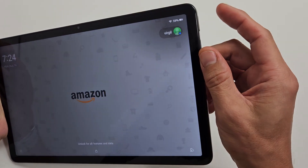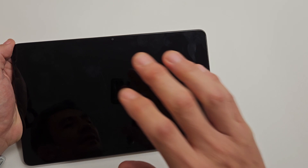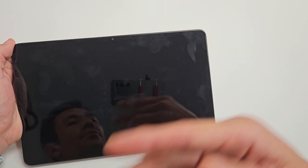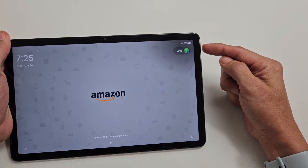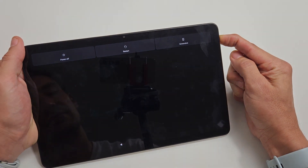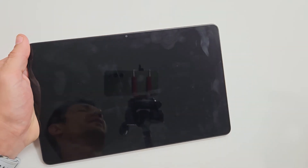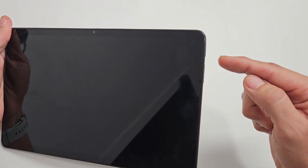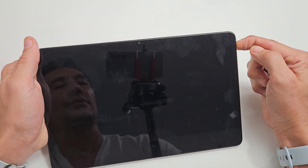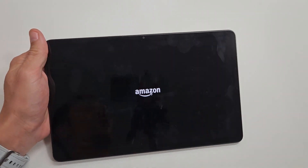So first thing — let's pretend I have a black screen here. I have a power button here, so the first thing we want to do is press and hold that power button for about 16 seconds, then let go. It's going to turn off completely. Then we're going to press and hold to boot back up — we're basically forcing a restart. Hold it for 16 seconds. Now let go and wait a few seconds, then press and hold that power button again and wait until you see the Amazon logo. Hopefully you have a working screen.